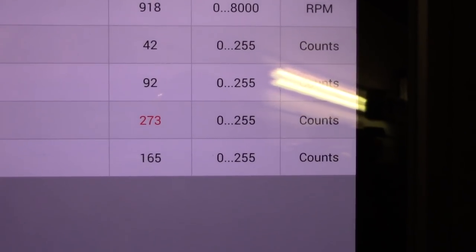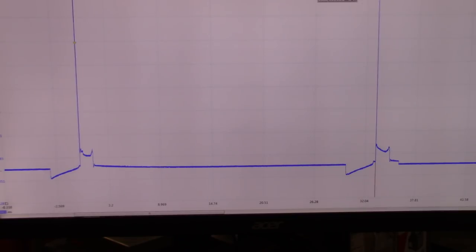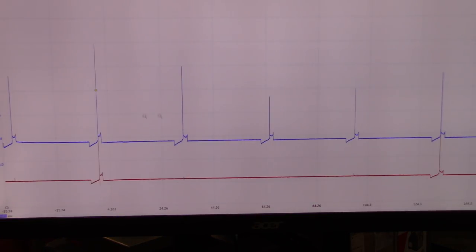Right now, as you can see on the scanner, cylinder 3 is in red numbers, so after 255, it's considered a random misfire, and then it triggers the MIL. And that's the issue we have now. I don't see anything crucial in there, and actually, when you accelerate the car, it gets better. Let me do a snap throttle. Yeah, now the check engine light is on. Like I said, after 255, that's what it does. I don't know why it's doing that.